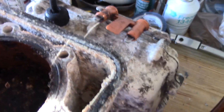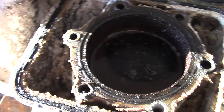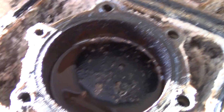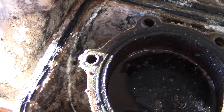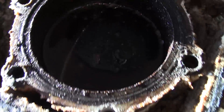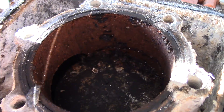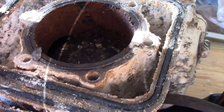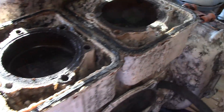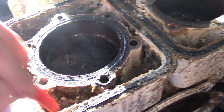Okay, so here is lesson number one - I want you all to see why you need to flush your motor out. I don't care if it's just fresh water or salt water. Look at this - these are all the water passages, the water cooling jackets, as Chris calls them. That's what surrounds the cylinder and keeps it cool. It's loaded with salt. The cylinders are rusted. Chris, do you think if I had these things machined, they can be saved if they're not egg-shaped? Even if they're rusty and corroded like that, can I have them sandblasted? Depends how bad it's eaten into the case.